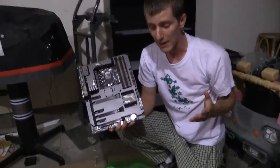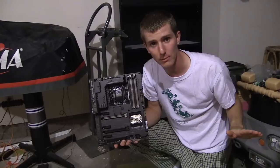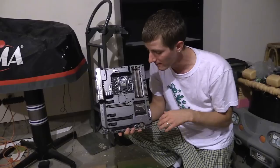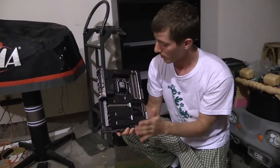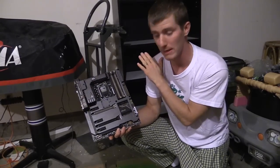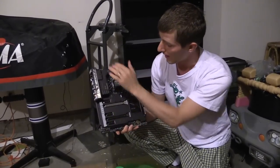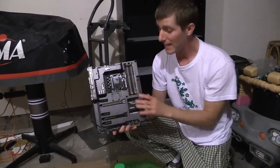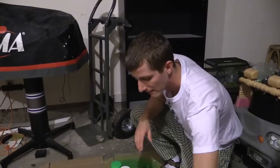The reason I'm doing that is I couldn't find any board that even remotely matched the color scheme we were going for. Gigabyte doesn't do their black and green color scheme anymore since Z87. So I figured we'll do our best with it — I'm going to pull off the thermal armor, stealth it, make it completely black, then put it back on. Once we install our RAM, plug in our 8-pin, plug in some graphics cards and cover up all this stuff, it should basically look like a completely stealth black board.